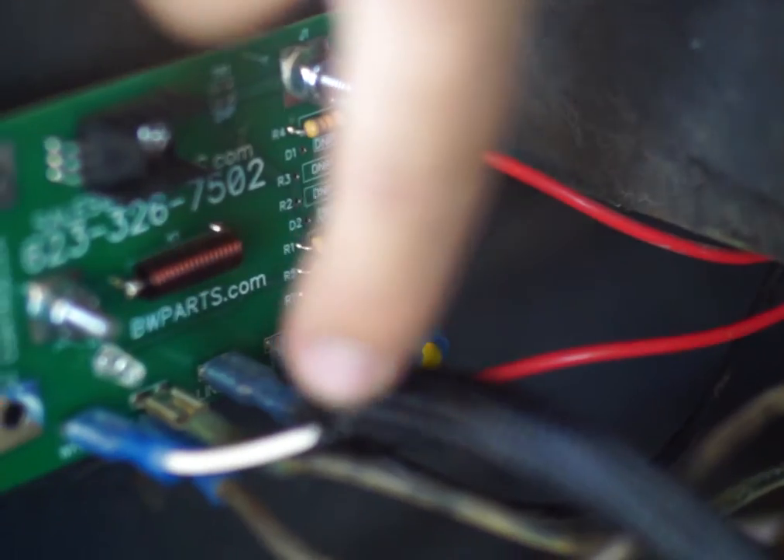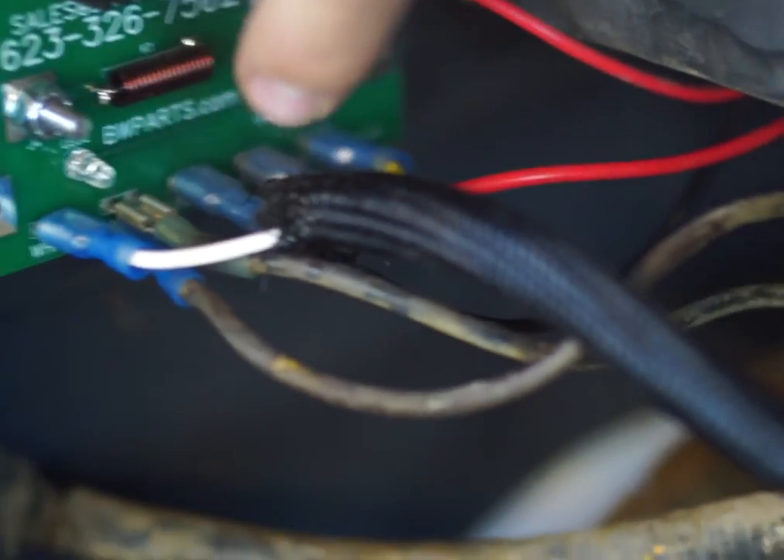But you pull that wire off and see how there's a black jumper wire? That black jumper wire goes down to where it says line two on your PC board. This one comes off of there and it goes into here — you put a connection on the end and that jumper wire goes right back to where those ones were.